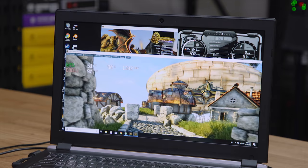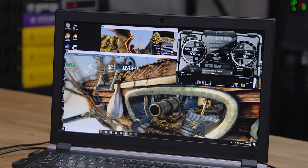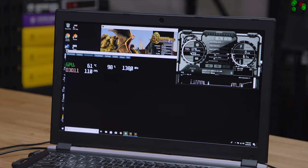So let's go ahead and do a plus 100 on the core clock. We can see what happens to our core speed right here. And it jumped up into the 1600s, but watch now that our temperature is gonna go up right here, 57°C, 58°C, this is starting to come back down towards the 1300s. As this hits 60, this will drop back down into the 1300s periodically. And a lot of our overclock, see there's our 1300s again, is being negated because this temperature is going up.